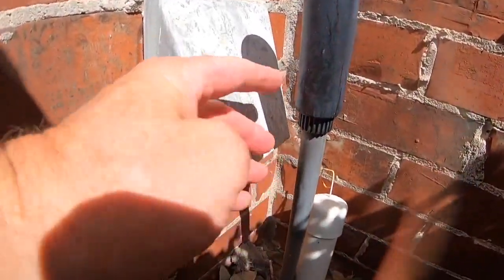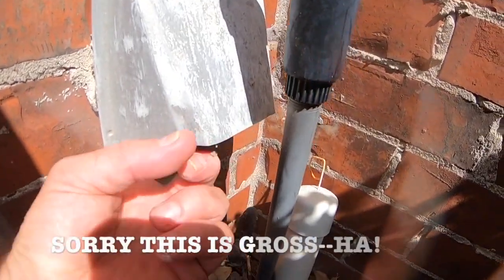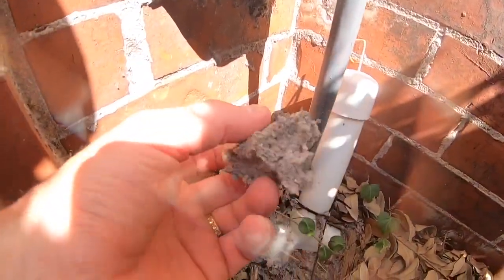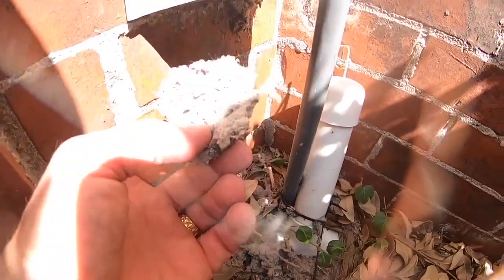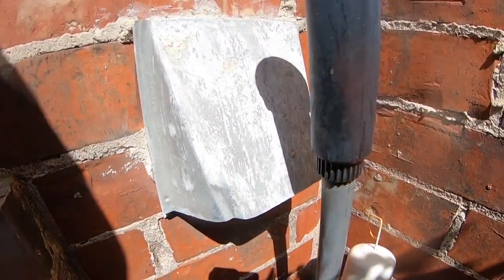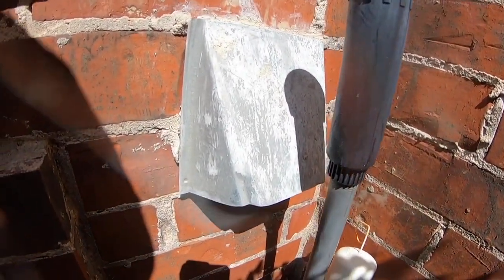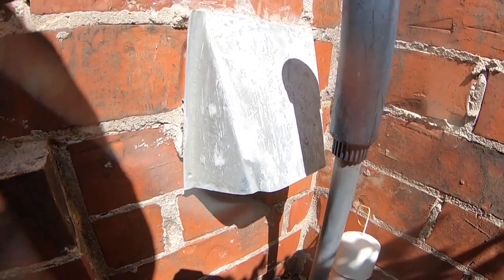Okay, so we came around here to the end of the house, and after we cleaned out the vent, one of the things I noticed, I could stick my finger up in here, and that trap door was not flowing freely. When you stick your finger up in here, look at that, big chunks of lint just came out. The problem is that was keeping that door closed and basically blocking the airflow, which was actually very dangerous. So we came in here, we cleaned that out. We cleaned the tube on the inside. We cleaned the tube going to the dryer. Then we cleaned inside of the dryer. We got it all out, and I think we're making progress. You have to have good airflow. There you go.